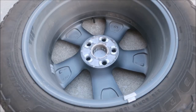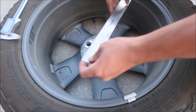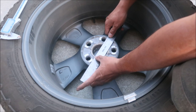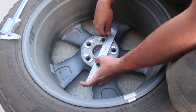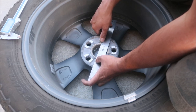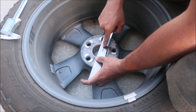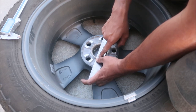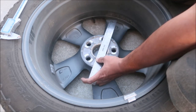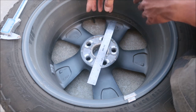This is the stock wheel — it should also be 60 millimeters. Using a ruler to bisect and measure the bore, I'm counting to about 60 millimeters. It's not perfectly precise, but this wheel has a 60 millimeter hub diameter and it self-centers. Now let's go check the Evo wheel bore the same way.